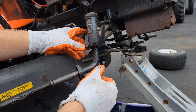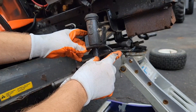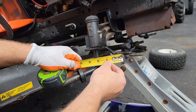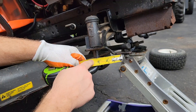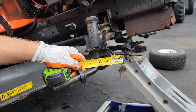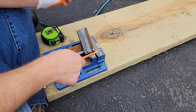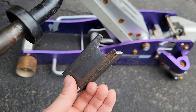What we're going to do is make a little reinforcement that will go from this center axle to the tab right here with the angle iron, and that will make it so it'll never bend again. We want it to be long enough to support this but not long enough to get in the way of the tie rod — going all the way back to the back of this, just under three and a half inches. We'll go with three and three-eighths. I'll make a triangle shape on the angle iron — you'll see it in just a second.